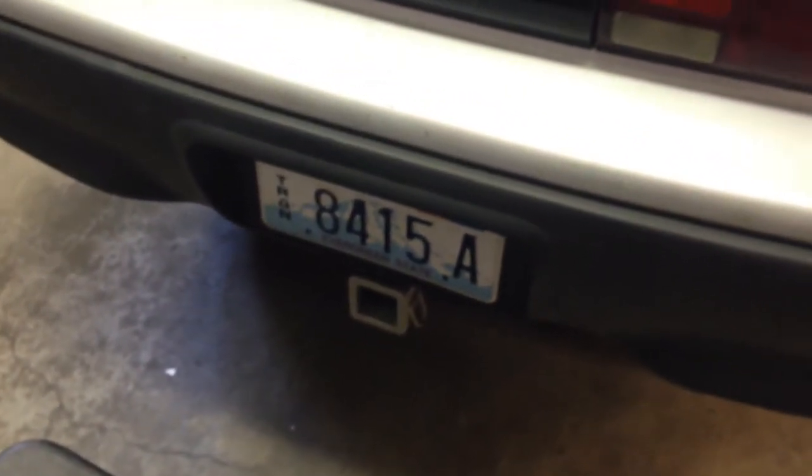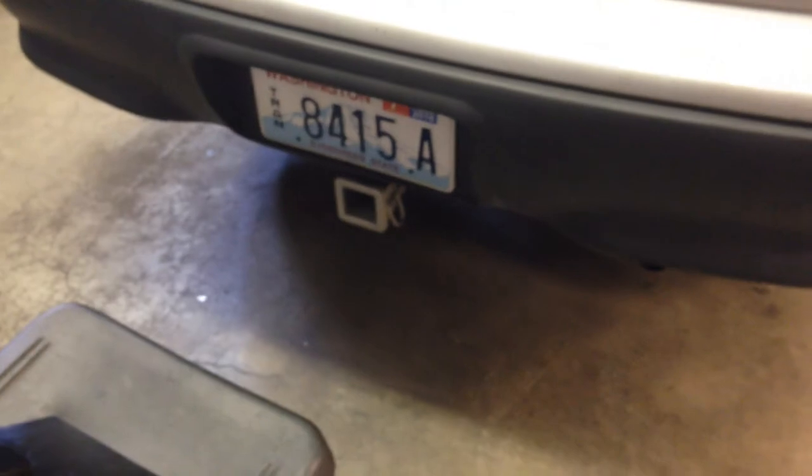When you're done, that's all you've got right there and you're ready to go. This is a great hitch — we've been using it for years and I've towed stuff that probably shouldn't have been towed. It's bulletproof. It's actually based on the base plate mount for a fifth-wheel unit on a full-size pickup truck — the 12-inch plate in the middle of the bed with four 3/8 bolts, rated at around 2,000–3,000 pounds of tongue weight for a big fifth wheel. We're really only putting 100 pounds on this, not a 10,000–12,000 pound fifth-wheel trailer.